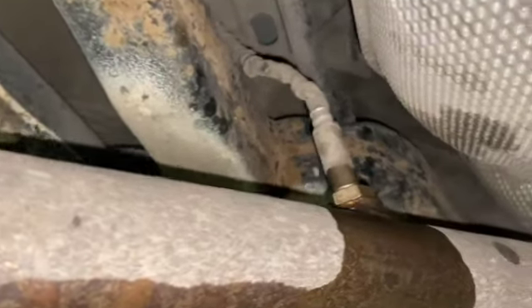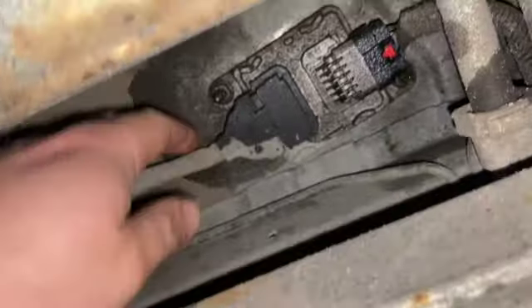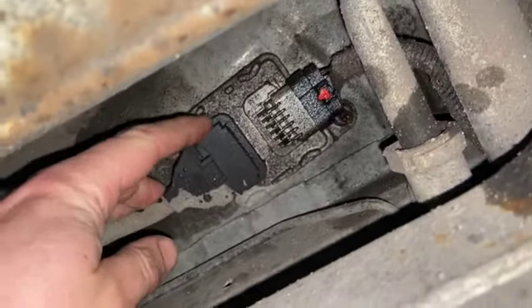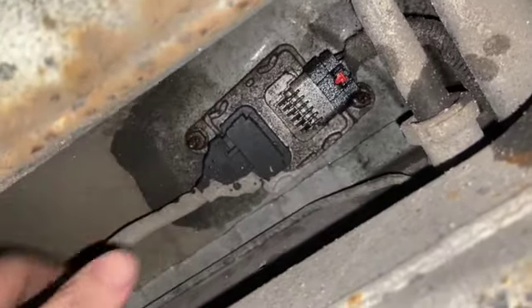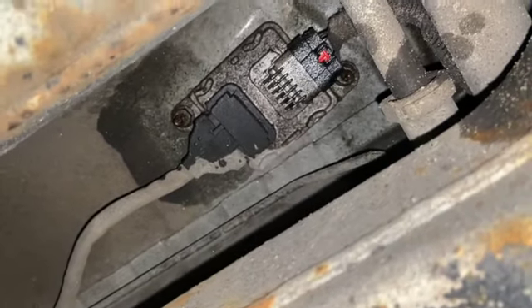You can just see it plugs in there — it's a 22mm bolt on it. Just follow the wiring up and they've actually got a little ECU as part of the NOx sensor, which is why they're mega expensive. But they're quite a common issue on these Vauxhalls, so we've got a new one to replace on this today.